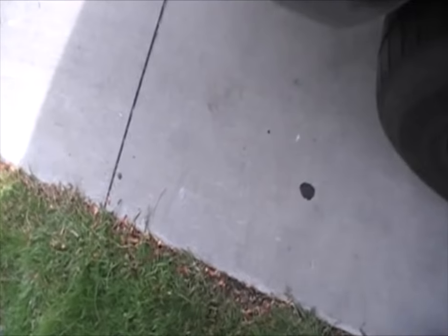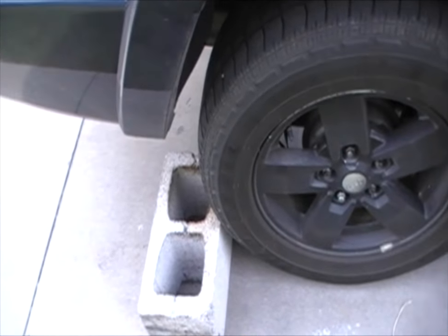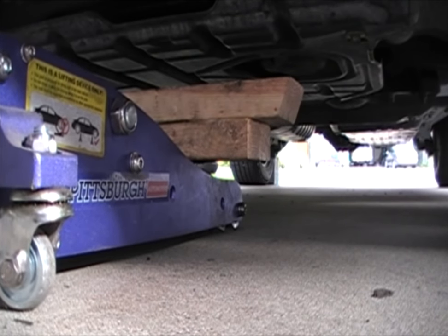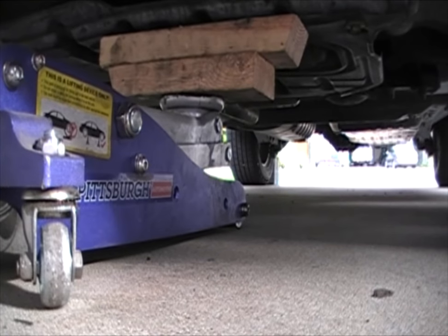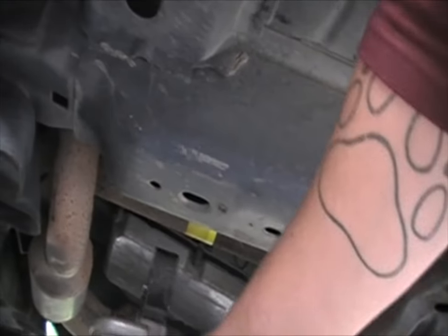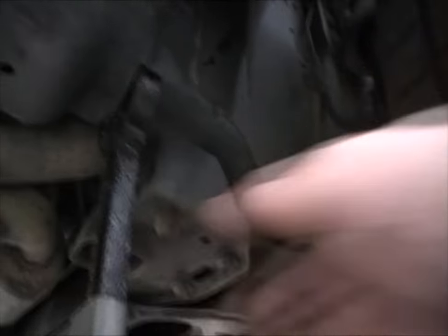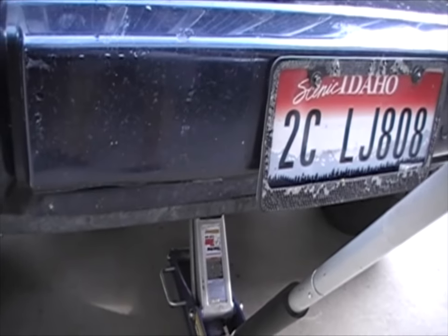That'll give it ventilation when we drain it. Next thing you want to do is grab a nice sized chock — it doesn't have to be that big — and throw it under the back rear tire, either one. Then you want to grab your jack, and with a couple of boards you want to jack up the front crossmember. Once the vehicle is fully jacked up, go around to the side, take a jack stand, and put it underneath the frame so that it's going to be safely supported. Make sure you do both sides so that you have plenty of room to work underneath the vehicle, and then slowly lower your jack onto the jack stands.